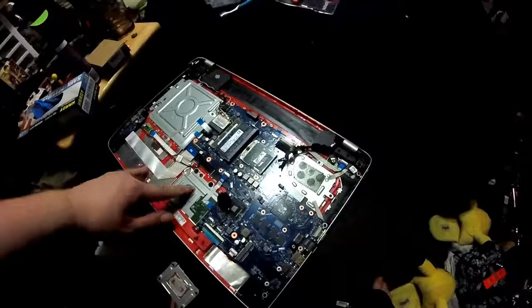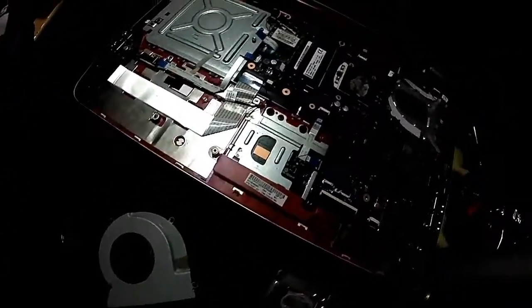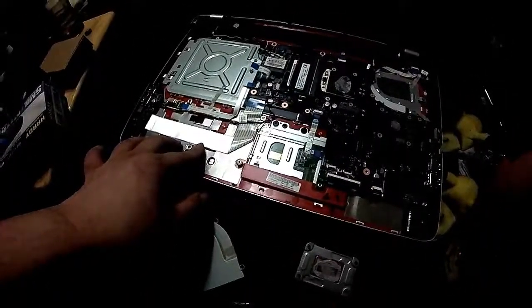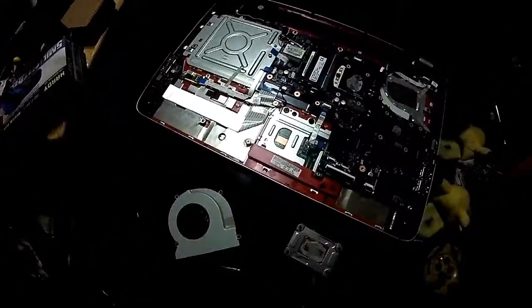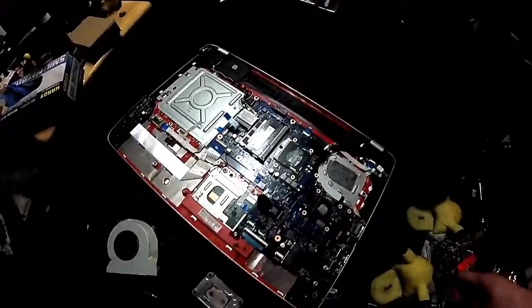I have two different drives in here. An SSD, like a 120 or 240 gigabyte Silicon Power, or a SanDisk 120 gigabyte, because you can get their monitoring software just to keep an eye on the health of the SSD as well as updating firmware. I would put a 2 terabyte HGST drive in here. I just prefer HGST drives because I've had very little issues out of them, and I have one that's about 10 years old and it's finally starting to show its wear and tear. The SMART status is dropping.